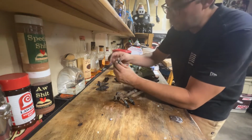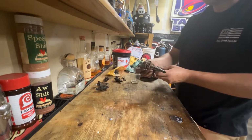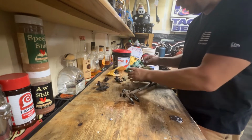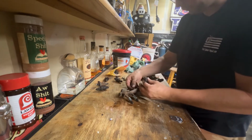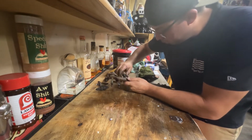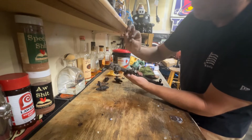Another thing too, when you're putting these in, make sure that this is facing in the correct direction as far as plugging them in. So we're definitely gonna want them just like that. So we'll wet this with fuel just a little bit. Kind of stick our finger in there like that. And then just give it a nice push in. Be nice. You don't want to mess up that O-ring at all. Boom. Plugs right in. Feels good. Then you should be able to put this clip in also, which will be bottom side like that. That's what it's going to look like.